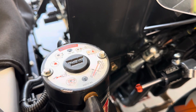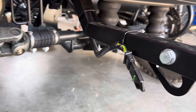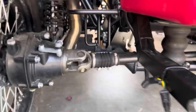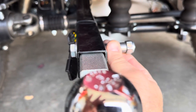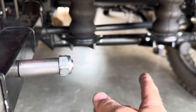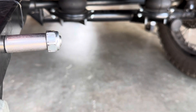I'm going to be modifying and making a new adapter piece. I've got my trailer wiring in — I haven't towed and don't intend to until the warranty's up — but I've got my wiring set up with the hitch plug at the back. I find if you're going to tow with this thing it's a little warbly back and forth. So I'm going to build a double piece that goes from here, clamps onto that part of the chassis or the frame for the sidecar, goes somewhere here and here diagonally, and connects up to here — that should stop the lateral sway.